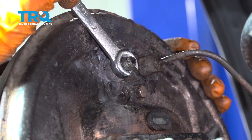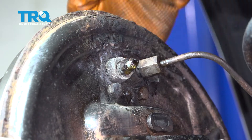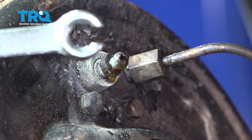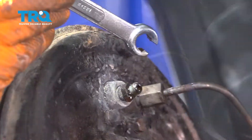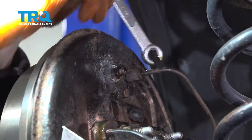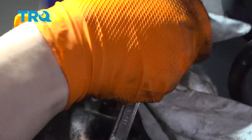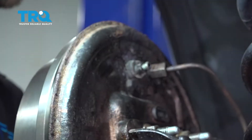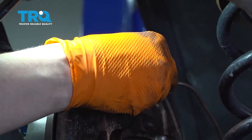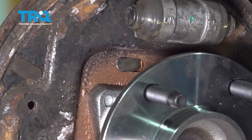Let's try to open the bleeder screw. Brake fluid will come out as well as some air bubbles — let all the air bubbles flow out to make sure we have no air in the system. Once done, you can close it off or perform a full manual brake bleed, which I recommend. Snug it, clean up the area so it doesn't look like a leak, and cap it off with the rubber cap. This ensures no debris makes its way inside and clogs the bleeder screw.